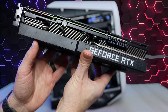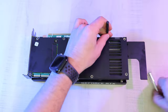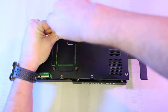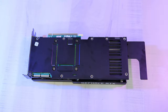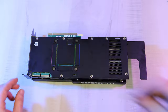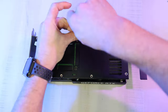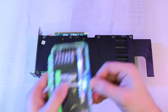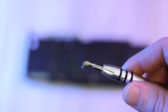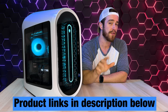Now that we've got the GPU out, we need to unscrew all these screws. Because the corner screws, middle edge screws, and center spring screws are all a little different, I recommend that you place these screws to the side in the same order and same configuration that they are on the GPU — it's just going to help keep you organized and prevent headaches when you're putting everything back together. You don't need a magnetic screwdriver for unscrewing, but for computer modding I recommend getting one for when you're screwing things back in, as it makes handling these tiny screws a lot easier. I'll put a link in the description below for the one that I recommend.